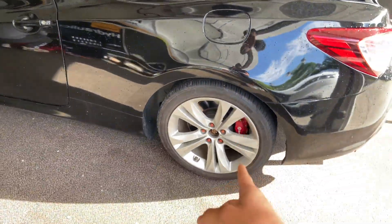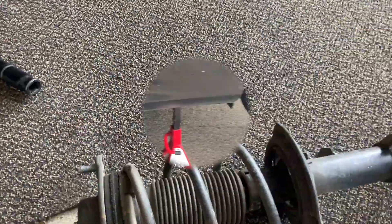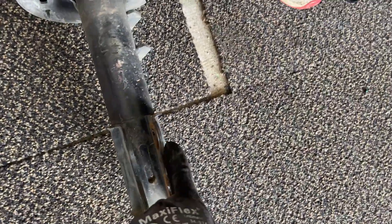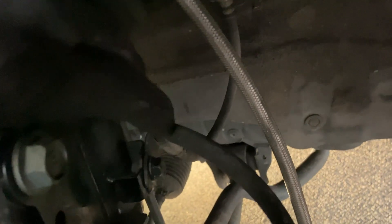We're also throwing on the other wheels he has. We currently got the car up on jacks. You're only gonna need a 19 millimeter bolt right here and a 17 right here. You're also gonna need a 19 millimeter to take the idler arm off, and then you're gonna need a 12 millimeter to take the brake line off. So we got the front currently done — this is a 19 millimeter, this is a 17, this one back here is a 19 millimeter as well, and the one that holds the brake line is a 12 millimeter.